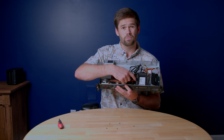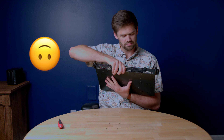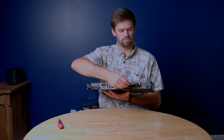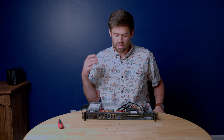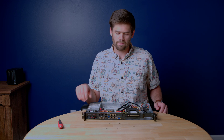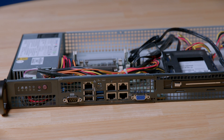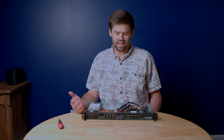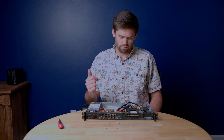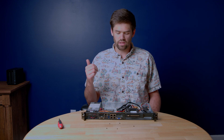There's also a spare PCIe slot, and I'm probably going to change out this little hard drive bay for a riser so I can put a 10 gig PCIe card in there. It's just got a ton of usable stuff inside. It does have a dedicated IPMI port, which is the Supermicro IPMI — but tragically it's running the full Java version of the remote screen connect, so I can't use it because Java is essentially dead. That's one unfortunate thing, but overall it's a great little server.